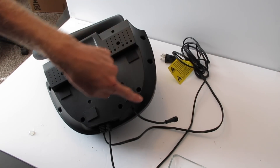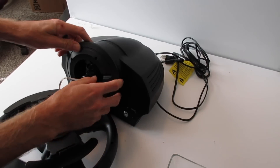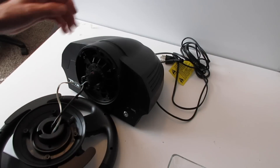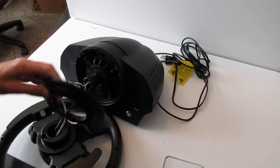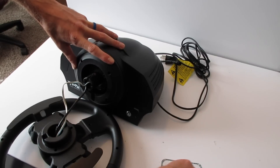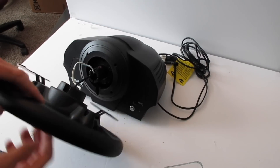Once all the perimeter screws are tightened down, we can start putting the wheel back on. Remember the trim piece needs to go on first — look for the groove at the bottom for the steering wheel screws, line it up, and place it on there. Before doing that, put the three screws in the center. Then slot the trim piece at the bottom, line it up and you'll feel it slide into place and lock so it won't spin. Put the four screws back in the trim ring.